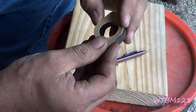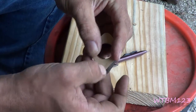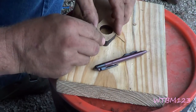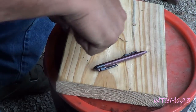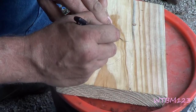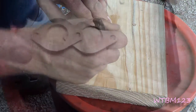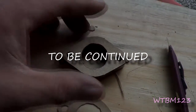So we want to get the holes in here marked for the bolt holes. I line this gasket up and hold it there, then just take my fingers and push — and you can see that is making an indentation. After I get an indentation, I can just cut here because I can feel the hole underneath. This doesn't have to be exact. Now I've got two gaskets cut — as long as those holes will fit over the studs, we're in good shape.